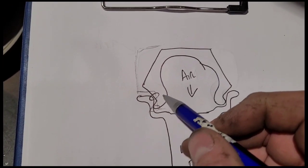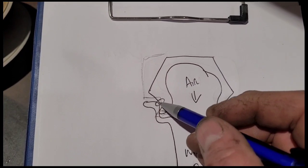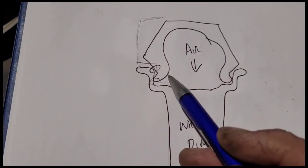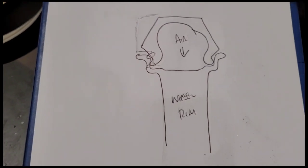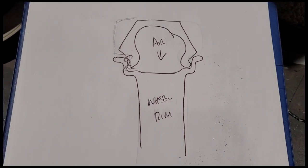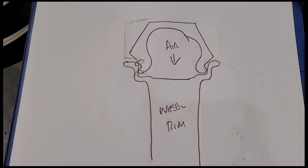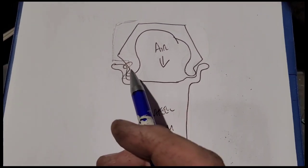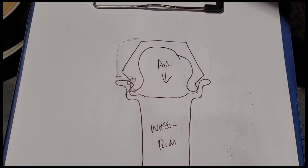You're putting excess strain on the tire because these are steel-banded - lots of metal wires inside the tire which are designed to sit properly and take force. When the tires sit stretched like that they're bending at the wrong angle, so you're not sealing because it's not seated properly. You put excess force on the metal inside that wheel, and as we know, if metal is bent the wrong way it fatigues, shears, and that's when you get a blowout. That's why I hate stretch tires. People say they've had stretch tires for years without a blowout - how many miles have you driven, how many potholes have you hit? It just takes that one moment when the fatigue kicks in, you hit a pothole, it blows out and you could kill someone. Get a tire that fits properly.